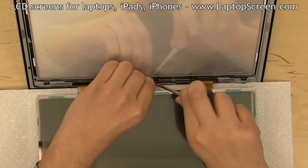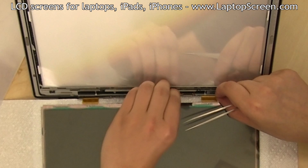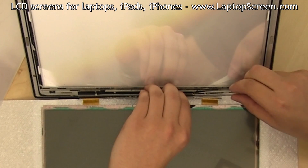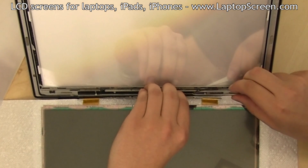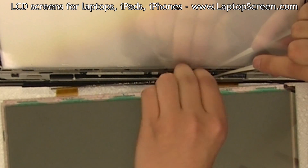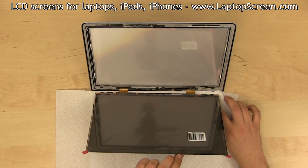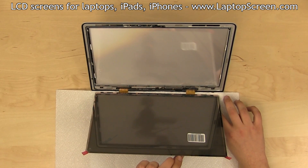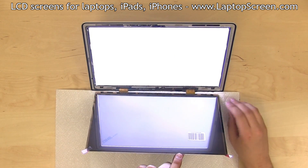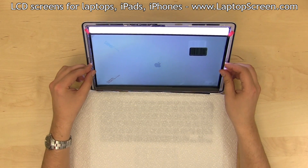Unbend the LCD board with the backlight flex cable attached. Reconnect the video connector by aligning the LCD board with it and plugging the board onto the connector. Secure the video connector's bracket. At this point, a loose test can be performed. Press the power button, and if the backlight and the startup graphics appear, both connectors have been plugged in properly.